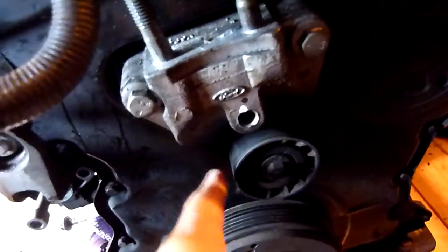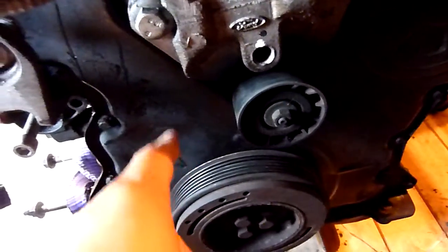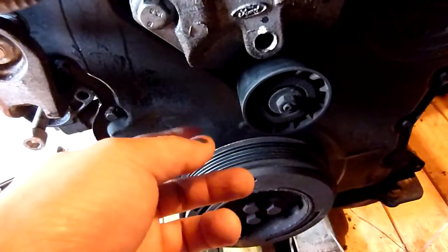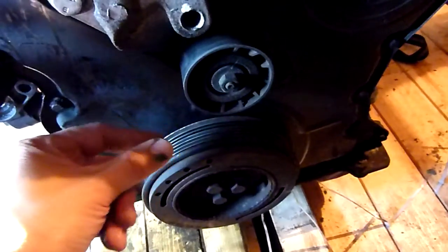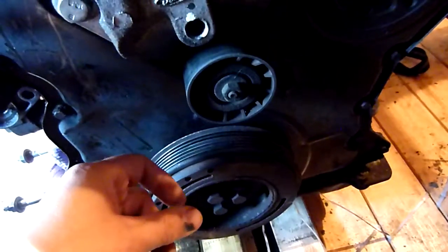Oh yeah, the other main thing is getting the drive belt off. No, the auxiliary drive belt off this side was difficult. There's a square nut that fits into the tensioner just here. I made my own square tool, put it in there, and there's not a lot of space. I'd use a flat spanner that's got a ratchet in it already.